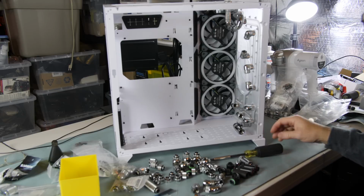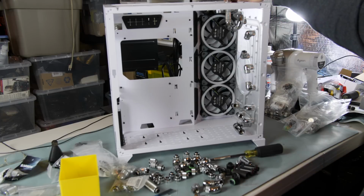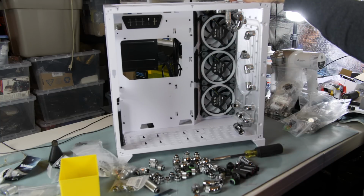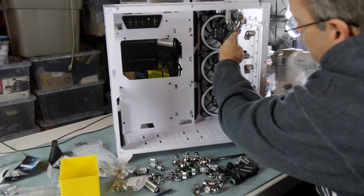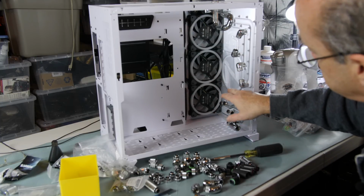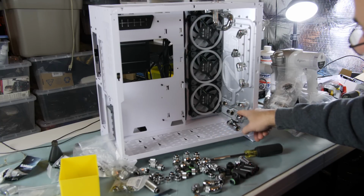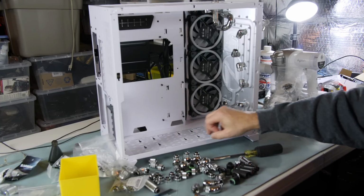I normally put it on the pump, which I haven't installed yet, but it's going to go in this area here. I decided to put in this fill port, and by the way, I checked the top, so the lid does slide on the top there. I had to get a very slim plug for it, but that works. And right now the plan is to have it come in and fill this reservoir, and then as this reservoir fills down, it'll go all the way down, come out, across, back down to this bottom section. There's a whole bunch of sections. And then there's a spot at the low spot in the back that it's going to come out and feed the pump and feed the loop.